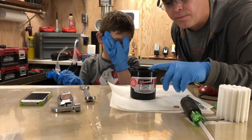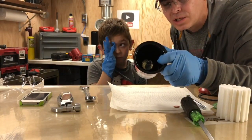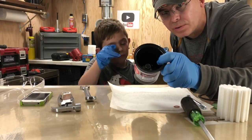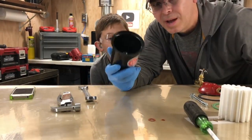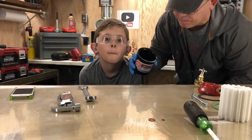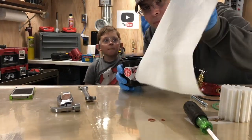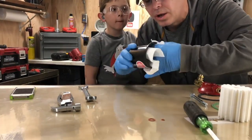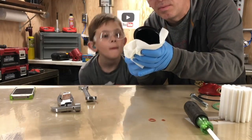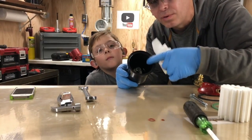Next, you're going to want to take your fuel canister and inspect inside of it to make sure you don't have any water and trash sitting in the bottom of the can. This is going to let you know if you have anything in your fuel tank getting into your fuel filter. After you inspect inside of your fuel canister, dump any leftover fuel into your bucket. Then take a paper towel, put it inside your canister, and wipe it really nice and clean. Wipe the outside also — it might take more than one paper towel, depending on how dirty your fuel canister is.